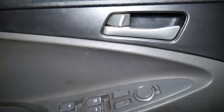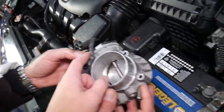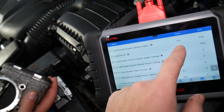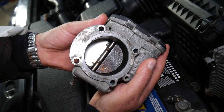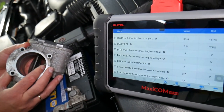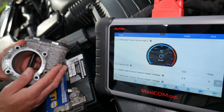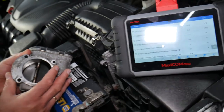Now what else could it be? We'll leave the ignition on - there will be a special video for throttle body testing, but check your throttle body angles as well to make sure they're working correctly. There's a special way to test the motor in the throttle body, but here we'll test the angle sensors to make sure it's calibrated and working correctly. Right now it's at 5.3 to 5.5 degrees on the throttle body flap. Opening it all the way gives about 88.8 degrees. Closing it halfway gives 50 degrees. You can open the graph to see it visually - all the way open is 88.8 degrees.